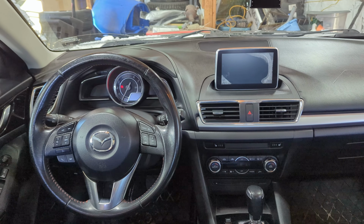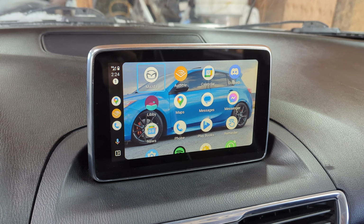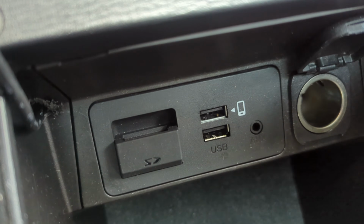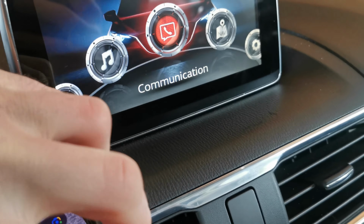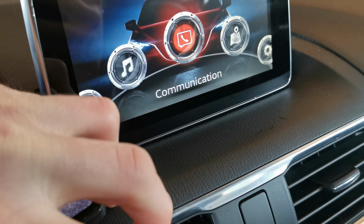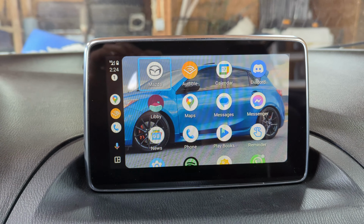And I did have some issues trying to upload it, and I missed a few steps the first times trying to get the program running right. I also had some glitches when I first uploaded it with the Android Auto. I think the problem is that Mazda Tweaks is made for a car without the Mazda Android Auto. So when I uploaded it and tried to connect my phone, it kept glitching out and the screen kept going blank. So I had to get that removed